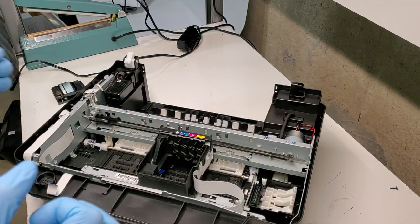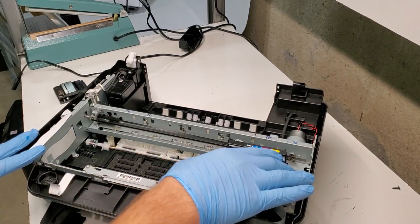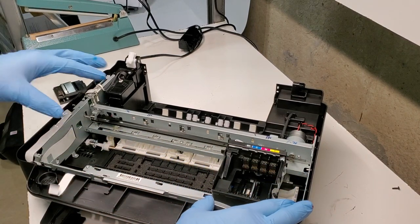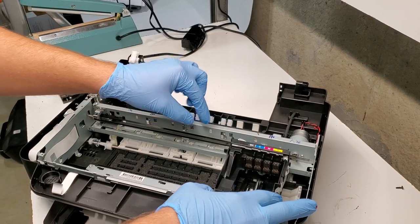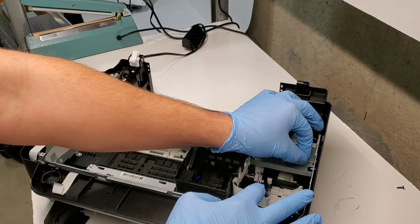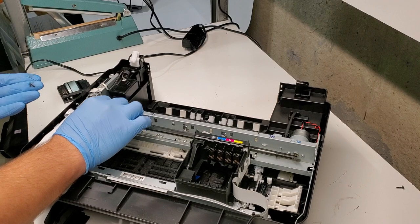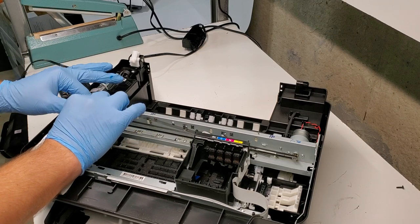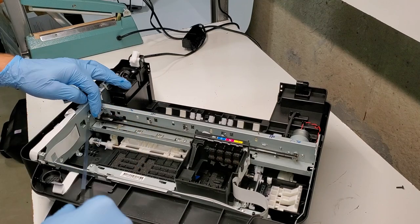Whenever you have this carriage unit going from side to side like crazy, it's usually an indicator that either this is misplaced out of the sensor area or that is ripped. Sometimes what I've had is a kid go into a printer and just rip it by accident, you know, just playing with the printer, and